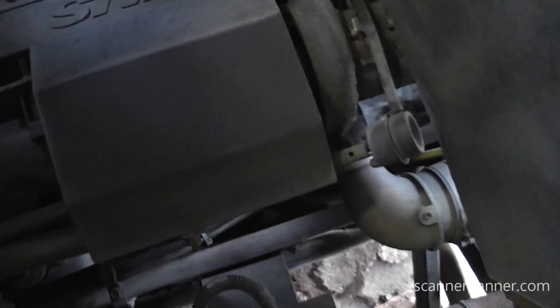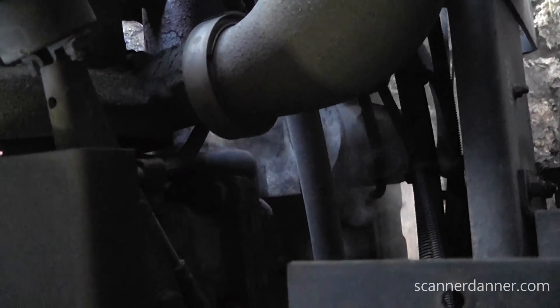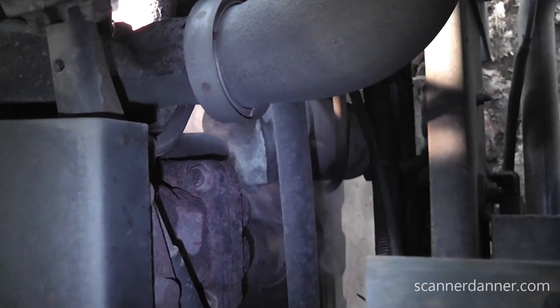There's my smoke — I see it. Is that the leak? Oh yeah, it's bad. Is that manifold cracked? Oh shoot, this has a cracked exhaust manifold. Seriously, that's really bad. I can see so much smoke — we might not take this on the trip. That is not a small leak, that is a lot of smoke. That's a huge crack, Caleb. I can't believe it — I'm glad I did this smoke test.